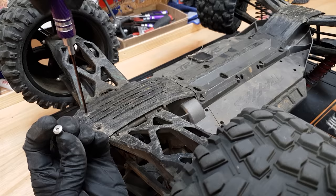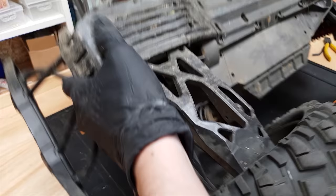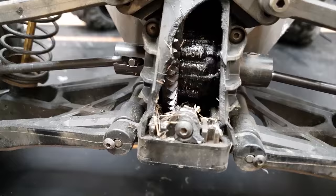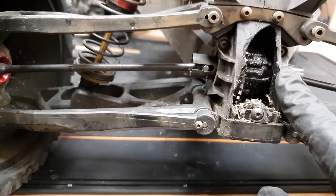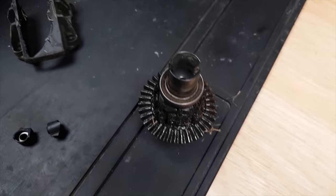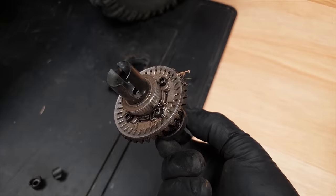Let's start with this diff cover. I'm using the hand tool here because these screw heads don't have much meat left — I don't really want to risk stripping off the hex. I've got a better look in here now and luckily this diff hasn't actually been skipping, so all I've got to do is change the cover. Actually, looking at this, it's broken off the bottom two lugs and the center one — how this hasn't been skipping around in there, God only knows. I've just got to get all that dirt and grass out of there.